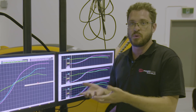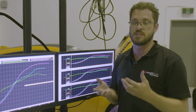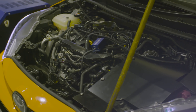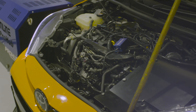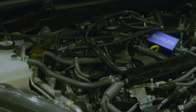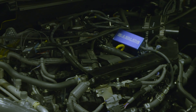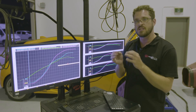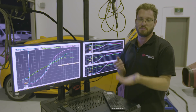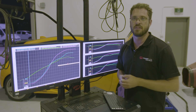That's not to say it can't snap a rod — those things you can't foresee. But at this point, as far as the surrounding parts of the engine go, there's no evidence it's going to give up anytime soon. The safe level with the current mechanical setup is about 260 kilowatts. Going forward, we need to replace the low-pressure fuel pump, replace the MAP sensor with a larger item, and potentially look at colder spark plugs and an upgraded coil, as we're just touching on the edge of some spark problems — though it's not yet known whether it's plug or coil.